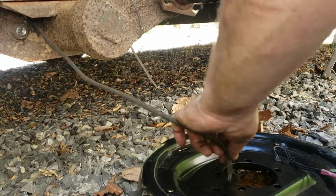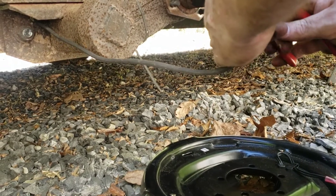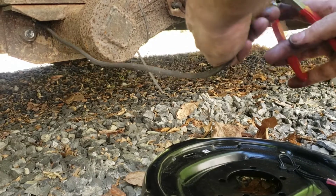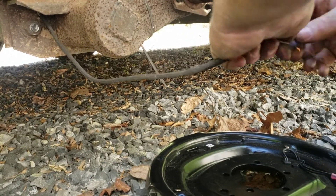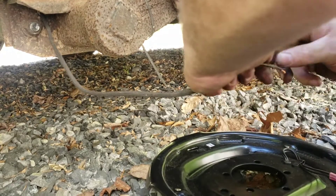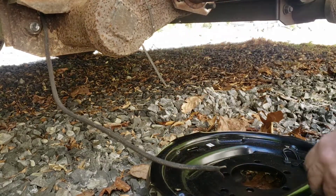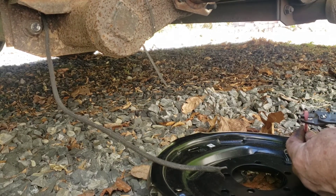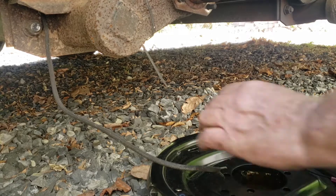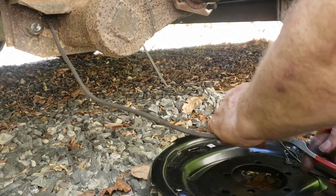Through the magic of television — all we do is give it a little splice. Strip the ends off like this. Here's a tech tip: when you're using butt connectors, put the butt connector in the tool first, and then put the wire in the butt connector — makes it a lot easier.